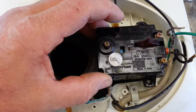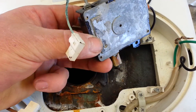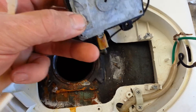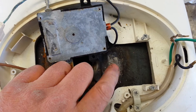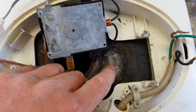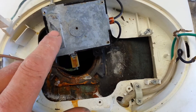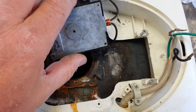It does contain a high limit switch. On the back side here there is a contact point right here and it mates up with the tank right here. I'm going to be applying some fresh thermal paste so that we can get proper heat transfer between here and the high limit switch so it can safely protect the tank.